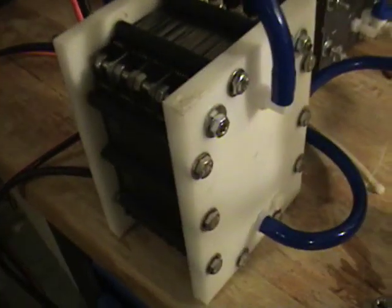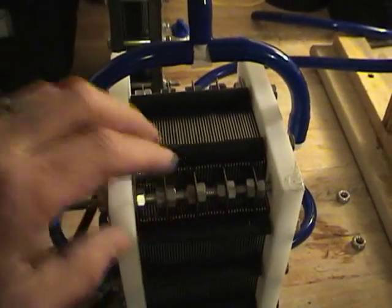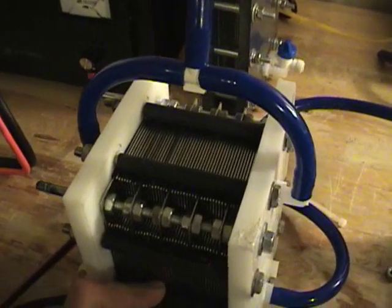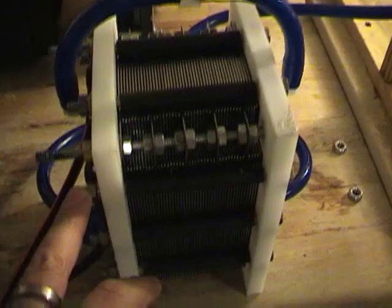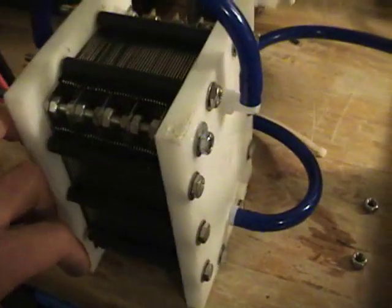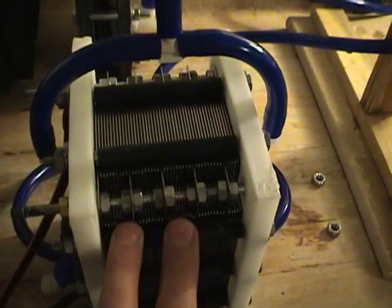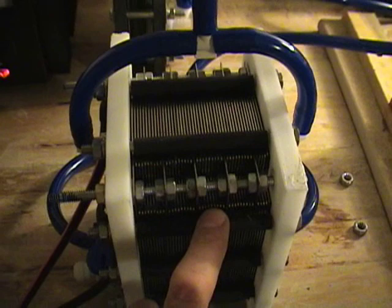I wanted to tell everyone about my cells. Each one of my cells is put together with high-grade stainless steel. The end caps are high-temp UHDPE and the gaskets are made out of EPDM. There are 46 plates in this unit. All my units use stainless steel bolts to bind the unit together — that's for corrosion reasons. If you have this in your car and use any mild-grade steel, you're going to have corrosion problems. For the power contact we normally use a brass bolt so it won't corrode and will always have a good connection. On this unit here we didn't have any brass bolts, so we used a steel one just for the test.